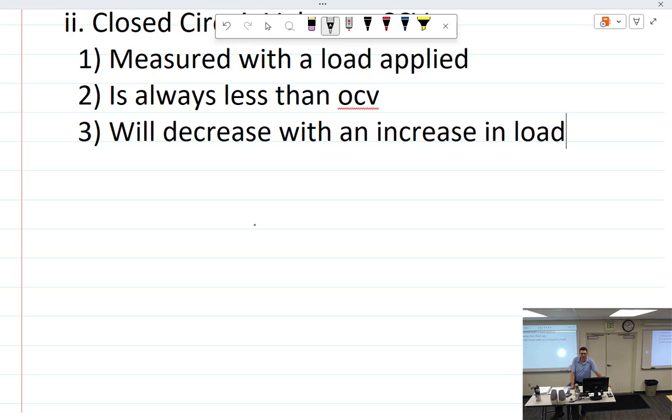Right, so with the battery tester, you could just hook it up to your battery, and that puts a load on it. That's exactly what that thing is. It's got 2 leads come off, a red and a black, and a little box that you hold the button. It's got a meter on it, so you just put that on there, and the meter is going to go to open circuit. You can leave it on there all day. Then you hit that load button, and it puts it through a big toaster element. You can toast on that thing, and after about 5-10 seconds, you can smell it burning.